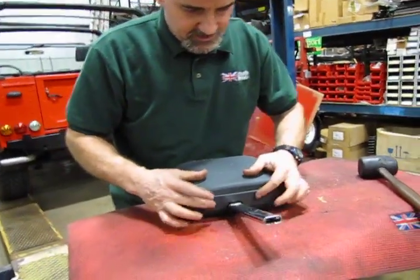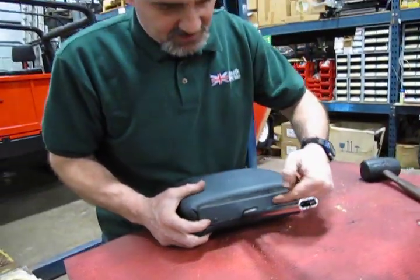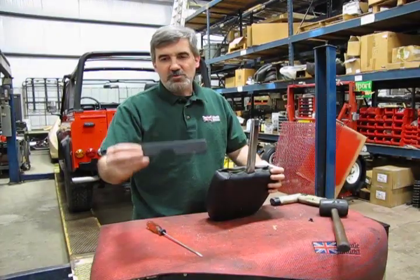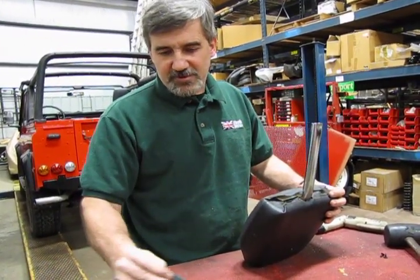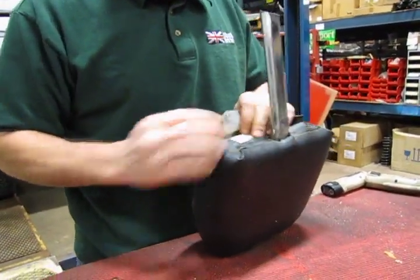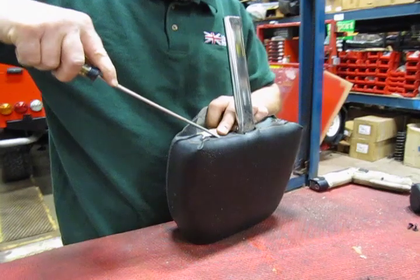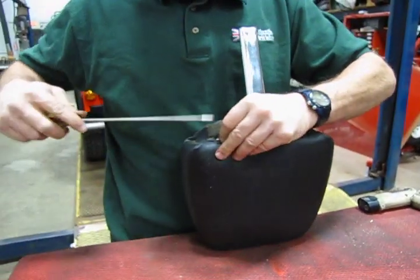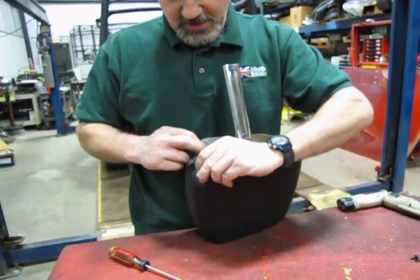On the bottom of the headrest, you have a metal plate simply held in with two Phillips screws. They actually use a block of wood inside that these screws run into. Once you remove the plate — and if there's any rust or corrosion on it, now's a good time to sand and paint — the bottom of the headrest is just simply stapled. The material is folded and stapled to a block of wood inside the seat. If the wood has been water damaged or doesn't look like it will hold its integrity, you can actually replace it.